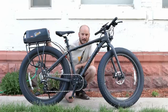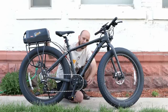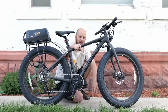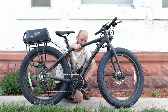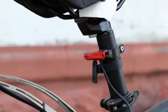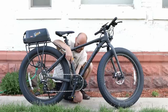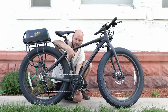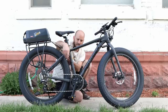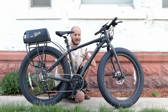Otherwise you have to put the battery on a rear rack like we did here. This is a 100mm bottom bracket — I don't believe they have a 120mm option, which may be a problem for true fat bike builds needing 120mm. They do come in 68 or 73mm for standard bottom brackets. One thing I noticed is that it has native outputs for a taillight and a headlight. The cable wasn't long enough to reach this taillight, but you could get an extension cable. It's nice that headlight and taillight are included natively by Bafang — you don't have to go third party.